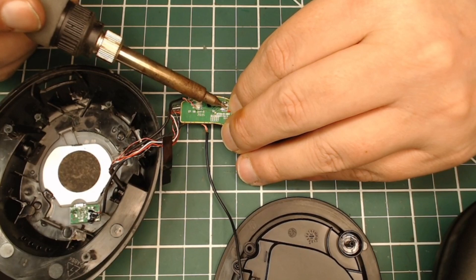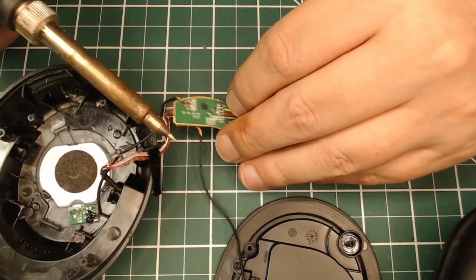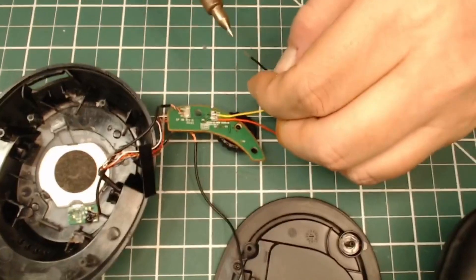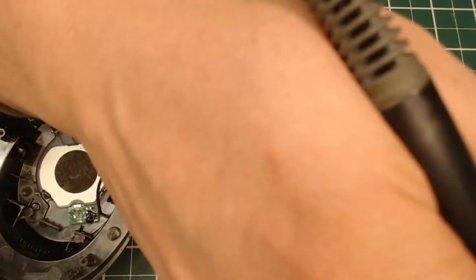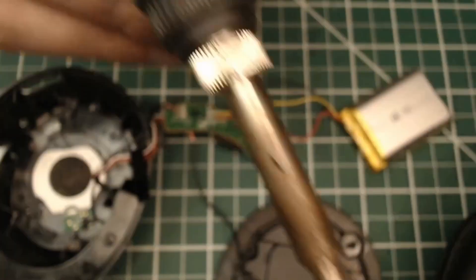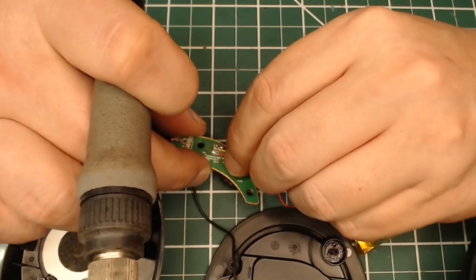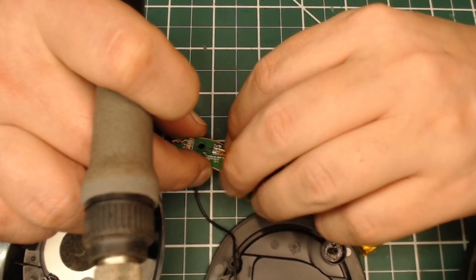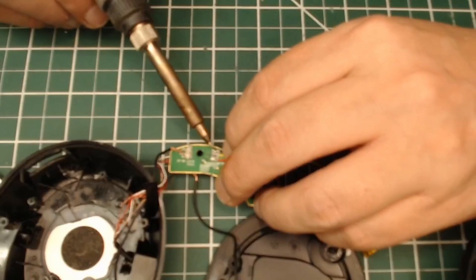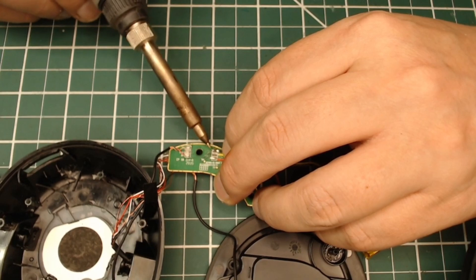Here I'm just soldering up — confirming the yellow thermistor wire. I don't have enough solder to pre-tin the black so I'm going back to get some more. Just a little bit of solder on there, put a little blob on there, pre-tin the wire. The new pre-tinned wire has some activated flux which helps flow into the pre-existing solder joint, making things a little bit easier.